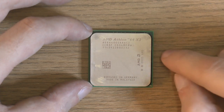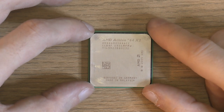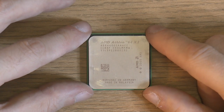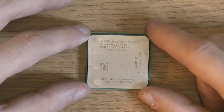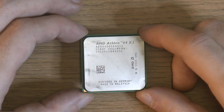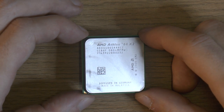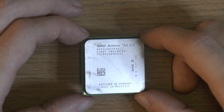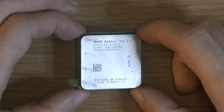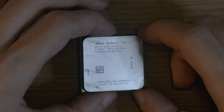And the thing is, the alternative was usually a Phenom, which has a quad-core CPU, but usually lower clocked with the TLB bug. This is quite high clocked and isn't that much slower on IPC. With the TLB bug factored in, this is probably faster. So in terms of games at the time, more than two cores and more than two threads weren't really used. A quad would be if you really wanted to, like, believing future games are gonna work on this machine and have more threads, and you wanted to pay more too. So you could either get this or you could get a Core 2 Duo.